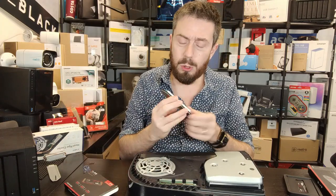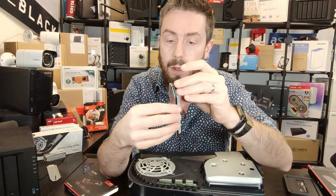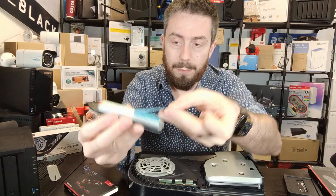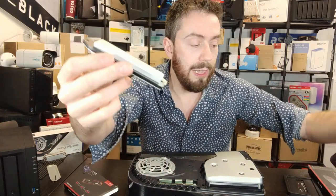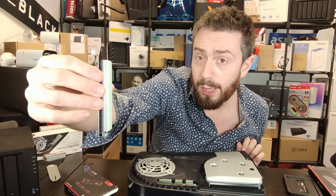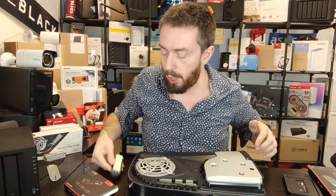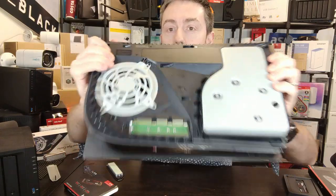Now, I talked about the base there. This is another very intriguing point for me here, because this obviously arrives with the thermal pad pre-applied. So if we have a look there, there is our thermal pad there on the base. So we're going to remove that because we're going to install an SSD for our next video. And the first thing that should hit you about it is, one, this is a 22110 length SSD heatsink there. That's right, it's going to fill the entire occupiable bay of the PS5 there at the bottom.